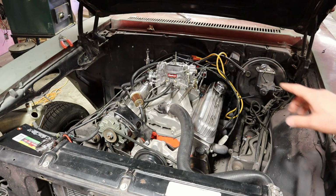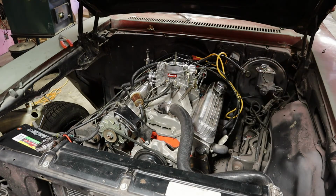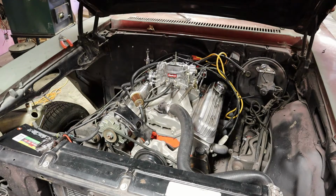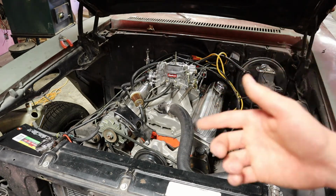Another thing that I did was take the fuel mixture screws off up here. I just took them all the way out one by one and then blew compressed air through those holes just to clear out the idling system on the Edelbrock carburetor. That still wasn't doing it, so hopefully now the issue is just a very weak battery.